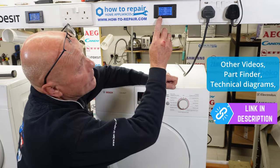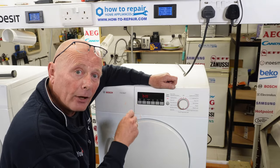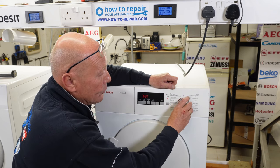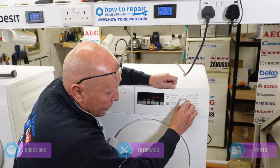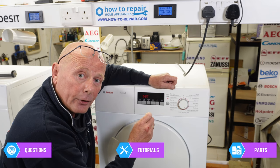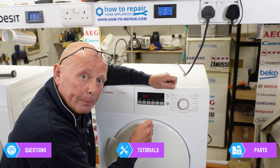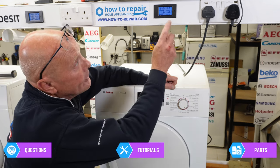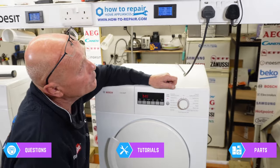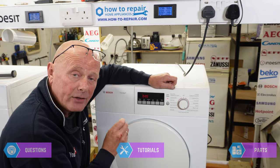The machine starts and we can see that the motor is pulling 163 watts of power. Now if you had that on a heat cycle and you were only seeing that, then you know you have a fault with the heating system. We know the motor is drawing around 160 watts and we know the element for this machine is approximately 2 kilowatts of power — 2000 watts. When we press start, we can see the motor kick in and now the heater pulling power as well. We are drawing 2293 watts, which is 9.5 amps. This means the heating system is working.